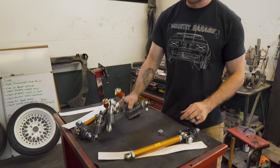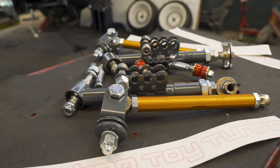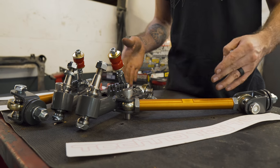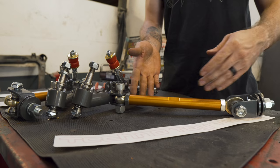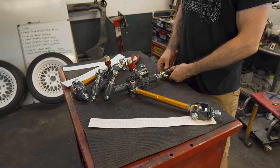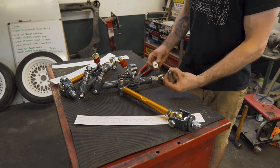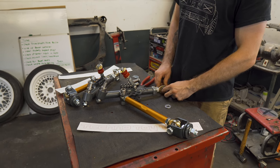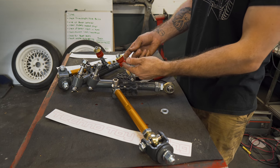So these are the GTX2 lower control arms from Techno Toy Tuning. It's a lower control arm and a tension control rod — whatever you want to call it. And this is basically your only control arm on a McPherson style suspension. So it comes with the lower control arm, the tension control rod, and a sway bar end link. And then it has a couple little washers zip tied to the end here, just to space it out in the subframe. So two all go on one side and two on the other. All of these ends have roller balls in them, so none of these joints actually have any poly in them except for this link right here.